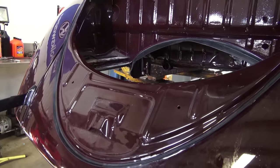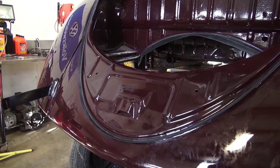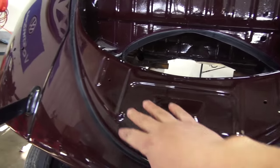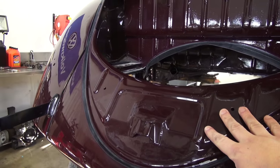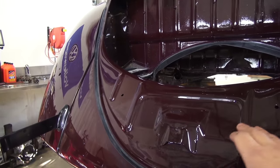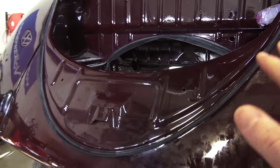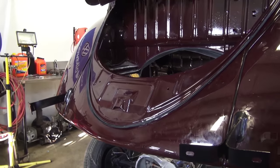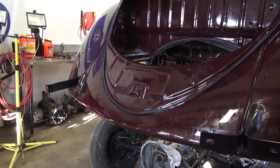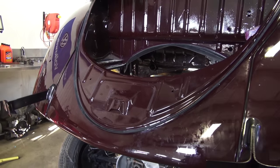In the past, we were at the mercy of aftermarket. If we had to buy that 65-66 style apron, you either had to save this top piece, cut the new piece off the new apron, use your old H pattern if it was still in good shape, and weld the bottom to it — or if you just didn't care, you got the new apron, found the catch, welded that on, and you would not have the H. But now, thankfully, they are making and pressing the H-style rear aprons for the 60 and earlier Beetles. You can get them from cip1.com or wolfsburgwest.com, and I think they're also getting them from guys across the pond, which is pretty cool.